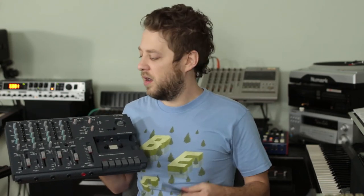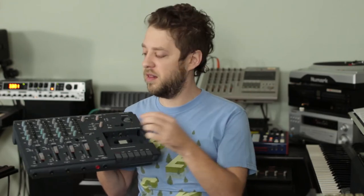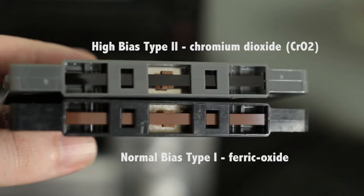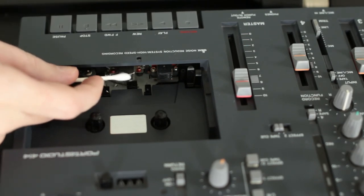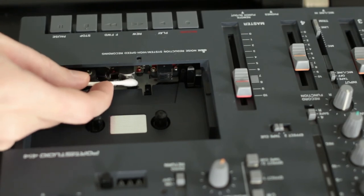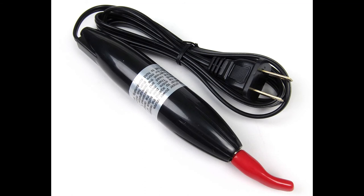These things are made out of plastic. I was moving and I broke the door off of this one. Knobs can fall off and faders, and some of these can be replaced easily online, but a common problem to be aware of nonetheless. Ultimately, you can avoid many problems like tape dropouts if you use the recommended Type 2 cassettes, and if you keep your tape heads clean with cotton swabs and rubbing alcohol or other recommended cleaning solution. Demagnetizers are relatively cheap online, although I have yet to have experience using them.